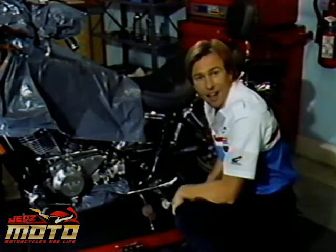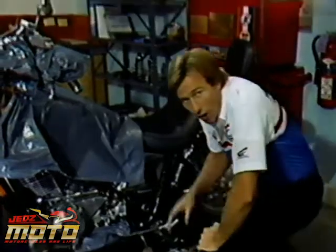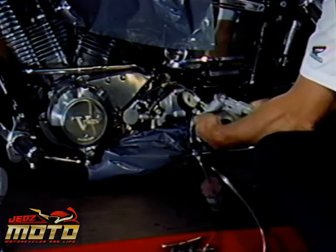Well, that's it. I'm done changing the fluid. All I have left is to put it all back together and verify that the clutch works. But here are some tips on what to do if you ever have to rebuild the master cylinder. Now, you still bleed it the way I just did, but if the system feels mushy or the clutch does not disengage on the test ride, there might be air bubbles trapped at the high point in the system.